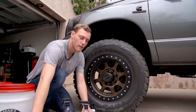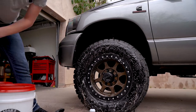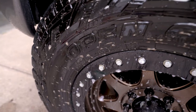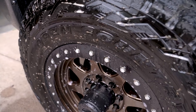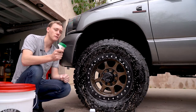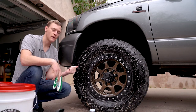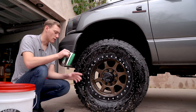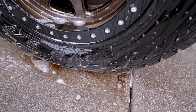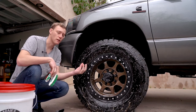So you're gonna start by just getting the tire wet — spray it down. Now that I've gotten it wet and sprayed the tire and wheel cleaner, you can already see how the brown is starting to come off the rubber. You can see that color change happening right there. Let this sit for a little bit, then come back with the brush and really go to town. There's no way to avoid it — you've got to put in some elbow grease with the brush. That's really where the magic happens, abrading the surface and getting that blooming off the tire, or in this case the old tire armor coating. You want to see the brown start running off and puddling on the ground in front of the tire — that's how you know it's done its work chemically pulling off the blooming and dirt from the tire surface.